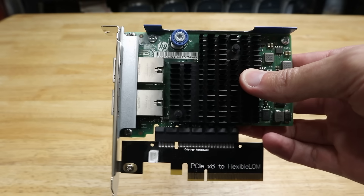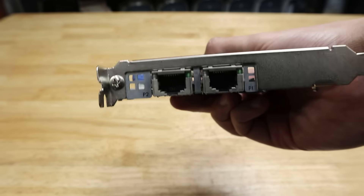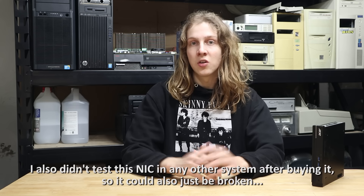The first thing I tried was an Intel X540T2 10 gigabit NIC, but unfortunately it doesn't work and would freeze the system during the POST sequence. The problem is almost certainly something to do with it being an HPE Flexible LOM card with an adapter, because every other PCIe card I tested worked fine, and these are known to have compatibility issues with some boards. I did try covering the SM bus pins with some tape, but that didn't fix the issue. I suspect the issue is related to the card, not the system, and I have no doubt a more conventional 10 gigabit NIC would work fine — but keep in mind you may run into compatibility issues with cards intended for servers.